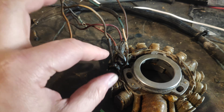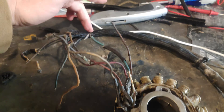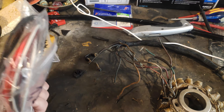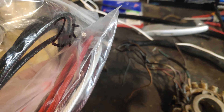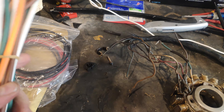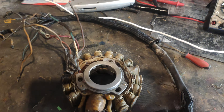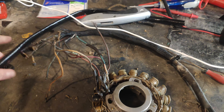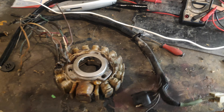My plan is to strip all of this, find out what state the wire is in, and replace the wires from there back up to about there. I managed to get some cooker wire — it's a multi-core silverized, siliconized, glass-fiberized cable — and then use the relevant heat shrink to tie that in. That will then go into this particularly nice glass fiber silicone sleeving, which will fit through there, so hopefully all of this will be repaired nicely.